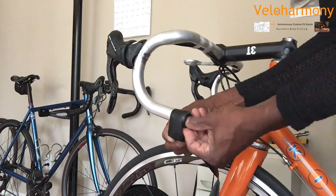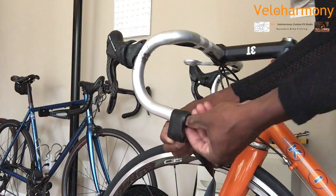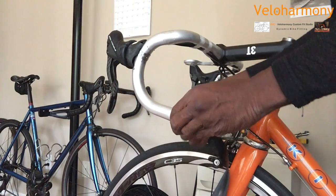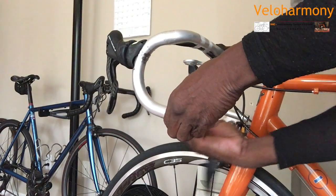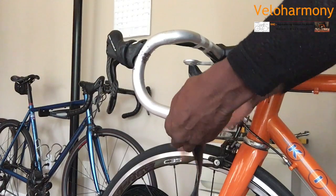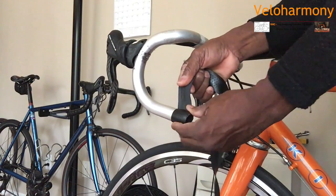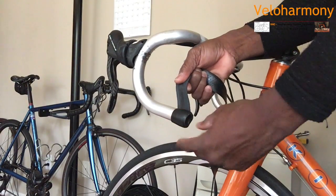A lot of times it will hang over. You don't have to worry about it. As long as you've got half of it hanging over the bar, that's what the bar end plug will push in. I'd already pushed that in before, because this bar had been wrapped before and I unwrapped it to do this video. As you wrap, the key is to wrap the same distance each time you go around.